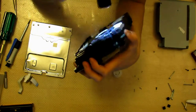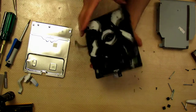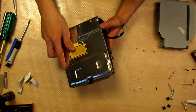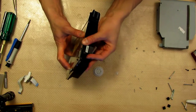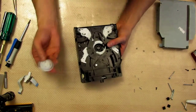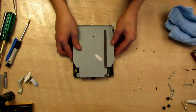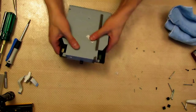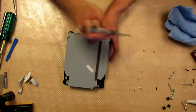Once you've verified this, go ahead and put it all back together. Take your lid and put it back on. Put your tape strip back on. Take the magnet that holds the CD-ROM down and put it on top. Now put your top lid back on and reinstall the screws as you took them out.